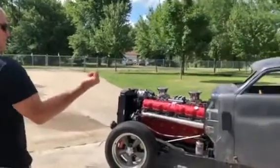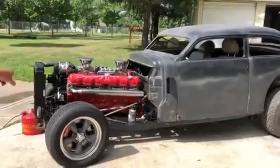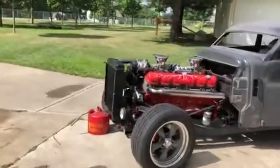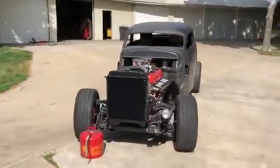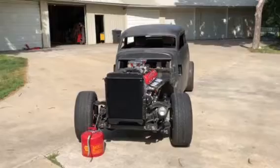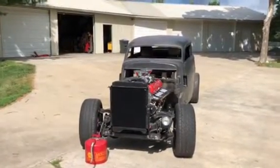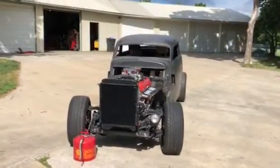The rear wheels are set out 3 inches of offset. The front wheels are in about 1 inch. So if you look down the car, the track is pretty close. And we actually have 18-inch wheels all the way around with the same size of brakes on a Corvette chassis. So basically it ought to handle like a big slot car when it's driving down the road.